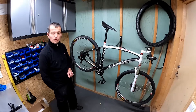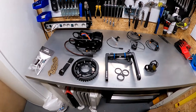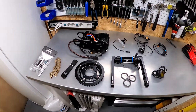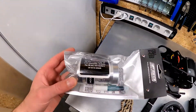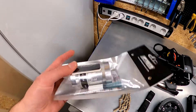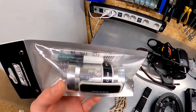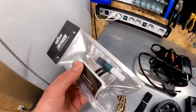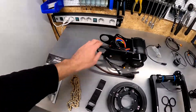Now I will show you all the parts coming into this build. On the table you can see almost all elements except the battery and the mounting bracket — I'm using standard batteries so I won't go into details about them. Starting with the first element: the adapter for the crank. Since this bike has a press fit 30 bottom bracket, I purchased this adapter to BSA standard, also called a threaded one, and this adapter will allow me to install the CYC motor.